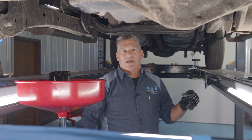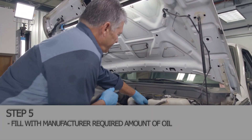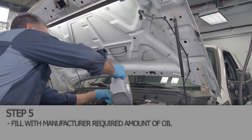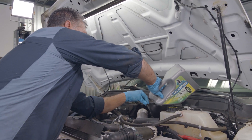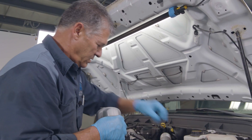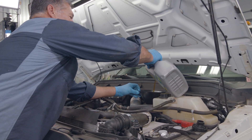We're going to get out from underneath here and let the truck down and top it off with oil. I've got all the oil jugs laid out — this is going to take probably about 13 quarts. Always check your owner's manual to make sure you're using the right grade of oil. There are winter and summer oils available if you're running in an extremely cold climate or extremely hot climate all the time — they give you different grades to use.